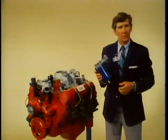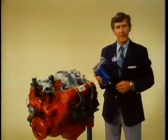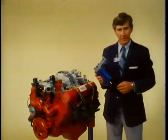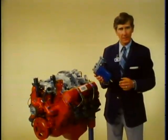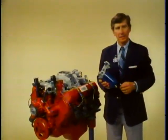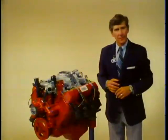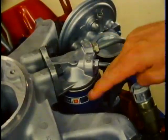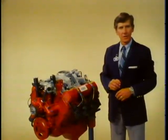To remove contaminants from the diesel fuel system, the 6.2 is equipped with two fuel filters. This is the primary fuel filter, mounted on the bulkhead in the engine compartment — the same type of filter used on larger trucks. A water drain valve at the bottom of the filter permits draining water caught by the filter. Open this valve and the one on top until all the water is drained out, then make sure you close both valves. Fuel flows from the primary filter through the fuel line to a secondary filter just ahead of the injection pump, which further guards against contaminants entering the fuel injection pump.